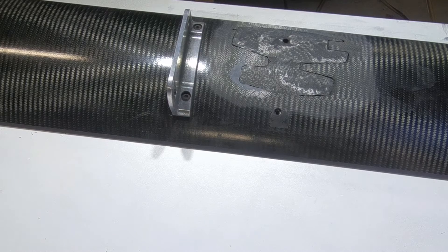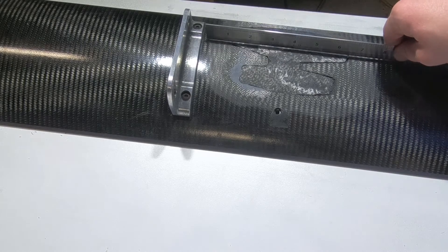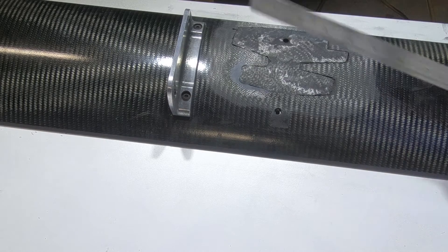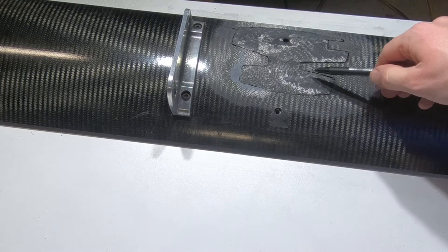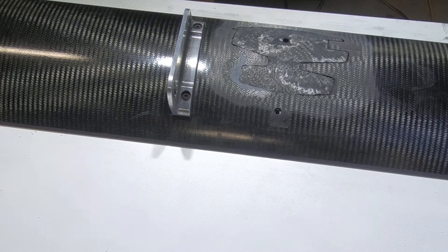That's been cleaned up. There's now a half-millimetre gap in between the top of the skin and the replacement — measured using a ruler and looking through the side for light. So now what I'm going to do is make up the patch and also make up the fill that needs to go in around these little gaps, and then we'll put that on.